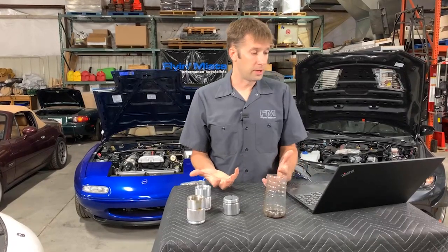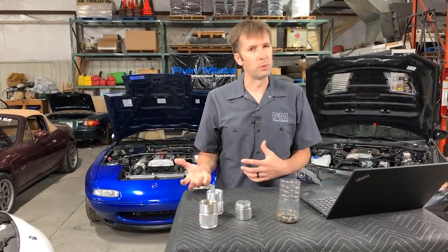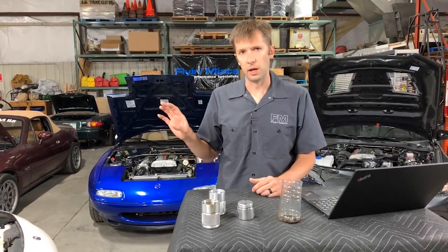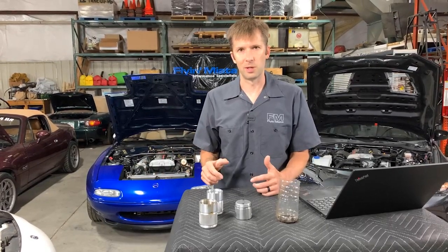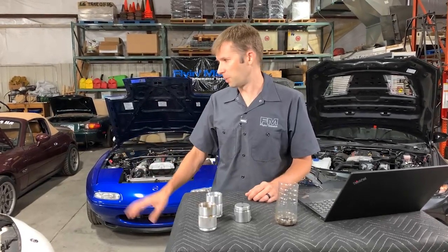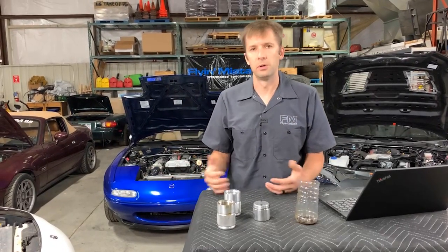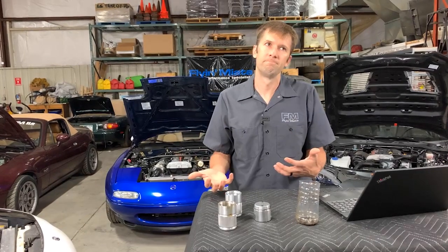For stock, healthy engines — is it beneficial? Yes, I still think so, and especially for direct injection engines like the NDs, but I would put them on any of them. I have four cars at home: three have catch cans, one doesn't because I just haven't gotten around to it. They're all internally stock, and they still pick up junk and still seem like a very good thing to do. Is your engine going to melt into pieces if you don't have one? No. Will you get a shorter lifespan? Probably, but shorter doesn't mean short. If you want to help it as much as possible — catch can.